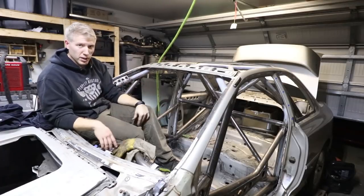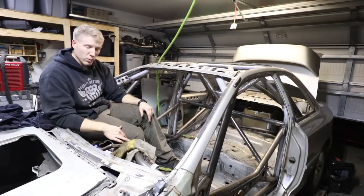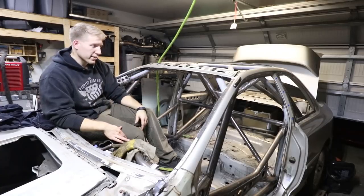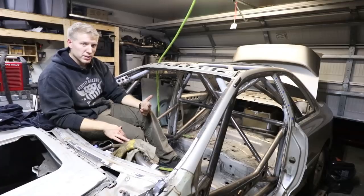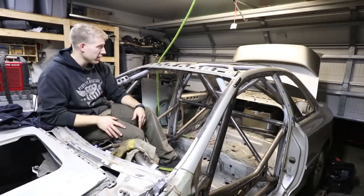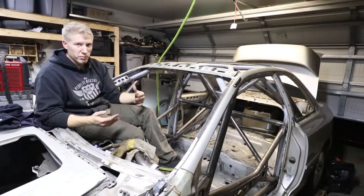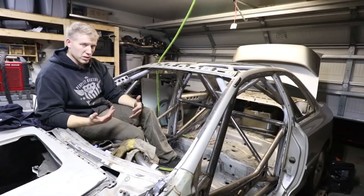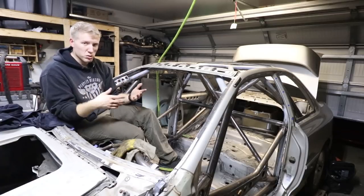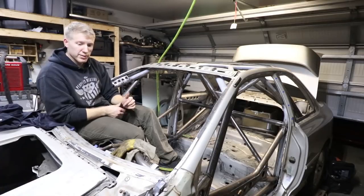Really quick just on the top - I am painting the interior white. That's why I'm getting the white spray paint; I'm not going to be spray painting the whole car. It's purely just for the top of the cage, because I'm not going to leave the roof off that long to actually set up my gun and get this place ready to paint in it. So I'd rather just spray paint the top - you'll never see it and it'll be blended enough to where you won't even notice. The main reason I'm even painting it is just for corrosion purposes.